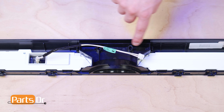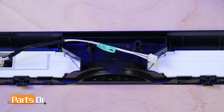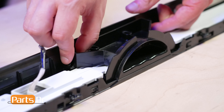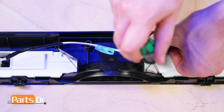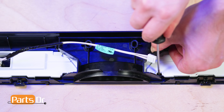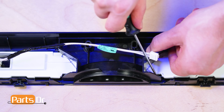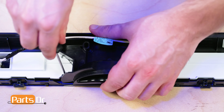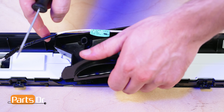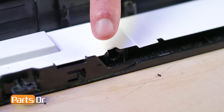The pocket handle is held in place by four locking tabs, two here and two here. To remove it, depress the two larger locking tabs while pulling the handle in the opposing direction. You may need to use a flat headed screwdriver to make this process easier. Then gently pry one of the smaller clips to free one side of the handle and repeat the same on the other side.